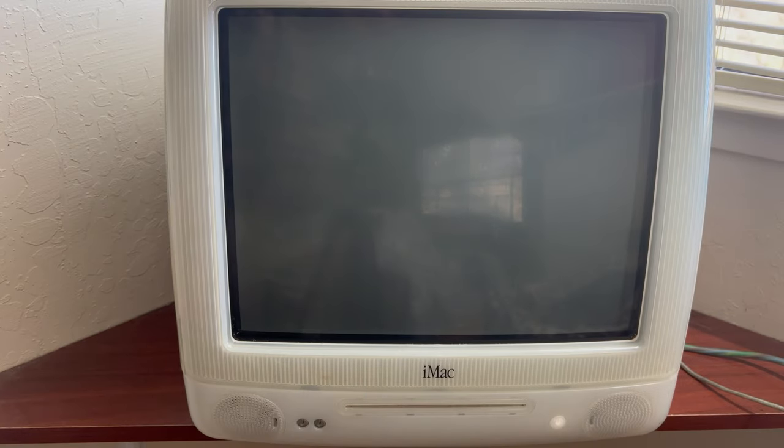You can hear it accessing the optical drive. You just hear the power down, board power up, and it is getting power. We do not get any USB to it. It's not powering up the keyboard, and that's what it does. So we're going to have to take it apart and see what the issue is. I will unhook the optical drive and see if that takes care of the issue.